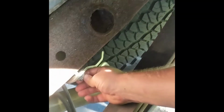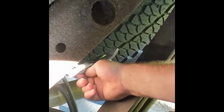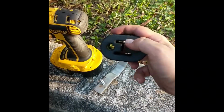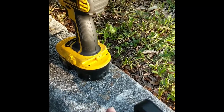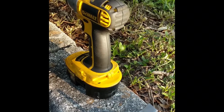Anyways, so the way I'm going to replace this, take a 13 millimeter socket, go ahead and fully take off this hanger. Okay. And essentially, bear with me, you're going to put the top portion of it just like this. Watch. Sorry. Doing this real quick. So this is going to go on the top part, just like that. Okay. So I'll do that and I'll be right back.